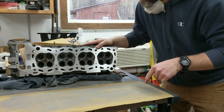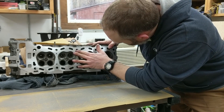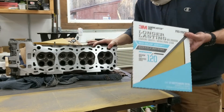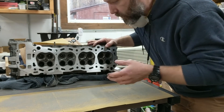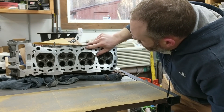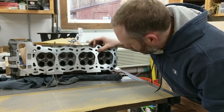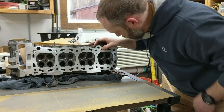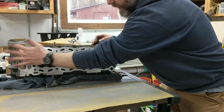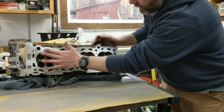I'm going to have to keep doing this, but it's getting late and I got to get ready for work. I was planning on coming back with 120 grit sandpaper, but they don't sand it from the machine shop — they just leave a machine surface. I'm thinking this 80 grit is even smoother than we need for a gasket surface; in fact I think you do want a little bit of bite for the gasket to seal properly. I've still got a little bit more to go — there's still some corrosion here I want to get down to. It's clean and pretty flat now and probably fine, but I do want to get it down to all bright metal.